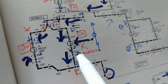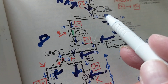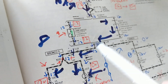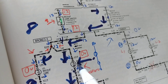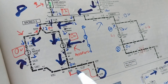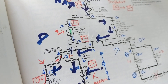Let's say both bulbs require 8 amps total — 4 amps each. I put my current meter here and only measure 4 amps. That tells me only one bulb is lit. There must be an open somewhere because I'm not seeing the other 4 amps — I'm supposed to have 8. Could it be a short? If it were shorted it would blow the fuse, and my fuse is intact. So it's an open, not a short.